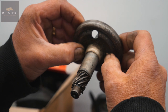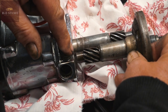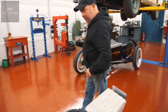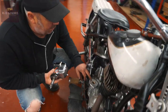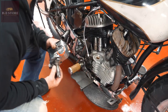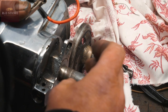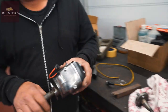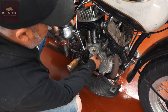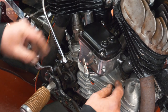What I've done is made a bush to centralize it in the casing, because your normal distributor sits down in that hole. That will centralize the shaft, because that shaft is bigger, so that piece fits down in the engine casing. We have to make a spacer because otherwise it's just going to be flopping around. The aluminium plate I've put on top takes up the difference in heights, so that should be engaging in the right place.